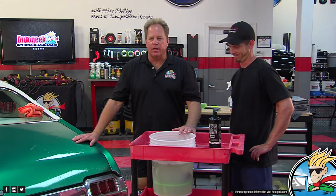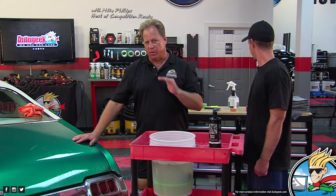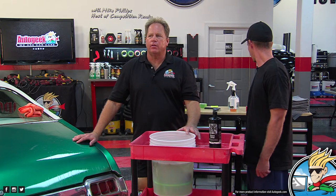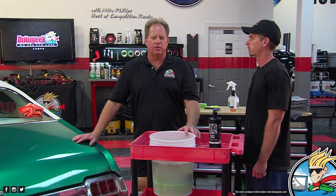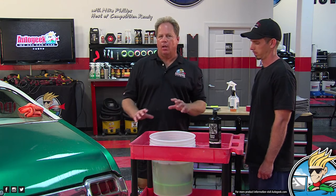Yeah. Okay, so then these finishing papers start, I think, at 1,000, 1,200, 1,500, 2,000, 2,500, and 3,000 grit. The 2,500 and the 3,000 are really so fine that if you've got a defect to remove, those aren't a good starting place. But the 2,000, because it has 100% distribution over the entire sheet of the paper, what I was always told was it'll cut as fast as anybody's 1,500 while leaving more paint on the car, because you're putting in a more shallow sanding mark pattern.